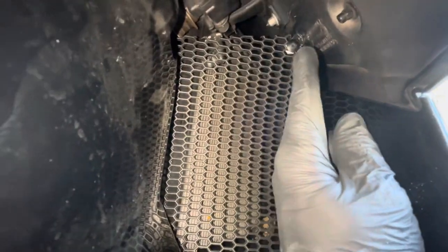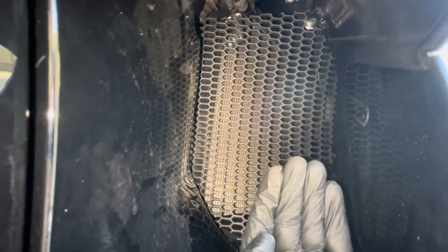Now that we've got the grille inserted into the rubber gasket and fully seated — meaning it's touching the body here — we're going to bring up the bracket to meet that stud there. We're going to reinstall the nut, and at that point we'll be able to bring the grille completely perpendicular. We'll mark the space where we want to clean off for our sticky pad, then clean it with the included alcohol wipe, and place the sticky pad onto the outer edge and snug up that cable tie and clip off the end.